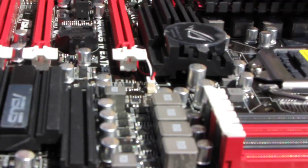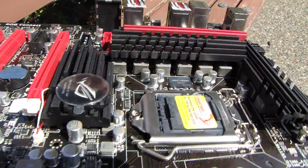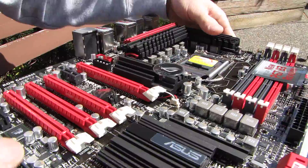You can see they're using a fairly different-looking design for the voltage regulation modules. Clean voltage to your CPU is very important for achieving the highest possible overclocks. They've done a great job with really neat-looking MOSFET heat sinks, as well as heat pipes that tie them into the Northbridge heat sink. The Southbridge heat sink is stylized similarly.